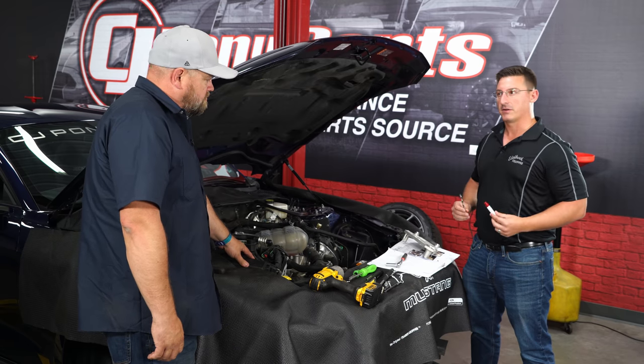To make more room for work, remove the two heater hoses — keep a rag handy just in case. Then remove the hard line to give more clearance for the supercharger installation. Now replace the hose that goes from the coolant tank — there's a new one included with the kit, routed a little differently. Install the new hose provided by Edelbrock.